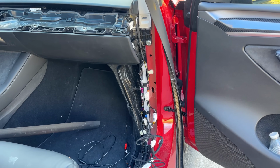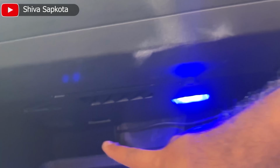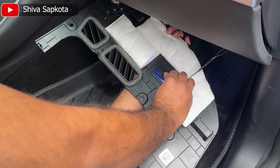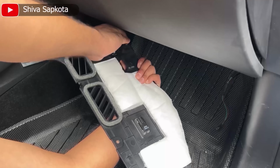Everything is happy. Now that was the AMD connection, but if you have an older Intel car, this is how you do that connection. You don't tap here. You just go underneath here and remove those 4 plastic fasteners, and you'll get access to the computer. 4 plastic screws. You can use a pry tool to remove them. Once the panel is removed, you will see the LED light connector, which can be removed by pinching on the middle tab and pulling it out. Then the speaker plug can be disconnected by simply pulling on the plug.